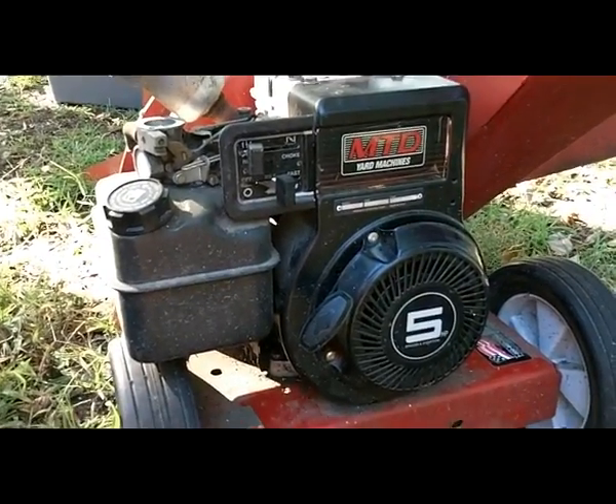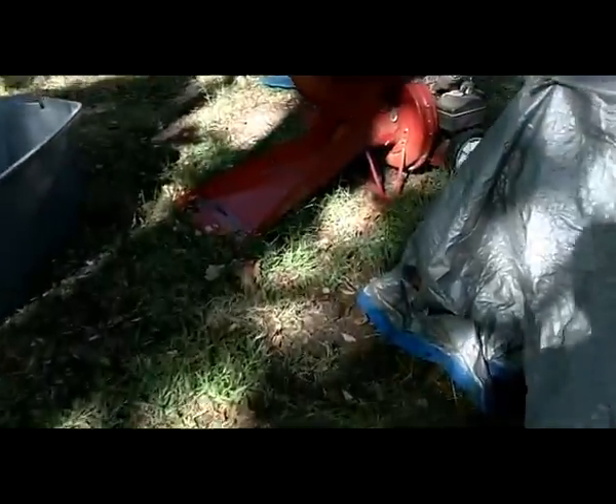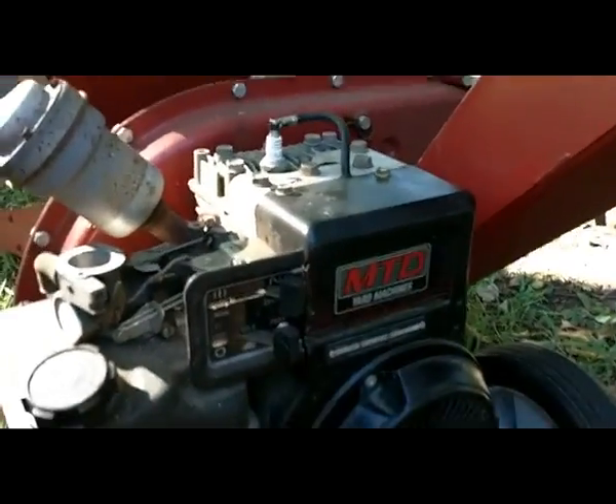What I'm going to do is shoot a little bit of starter fluid into the engine. I'm going to shoot some of this starting fluid into the carburetor because it's very flammable, and if I've got spark, this stuff will ignite. I've already removed the air cleaner assembly. So here's our carburetor, and I'm just going to shoot some of this in there and then try to start it and see if we get anything. Alright, so let's give that a shot. If it fires up at all, I'll put it on choke. And here we go.